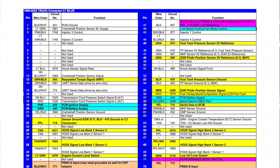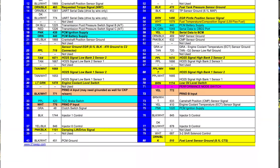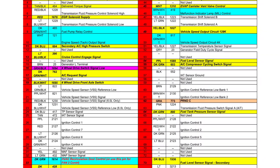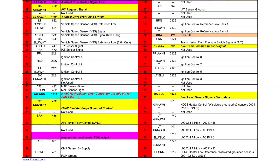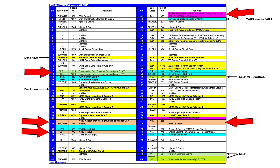The chart on lt1swap.com tells you how to do wiring if you're running the engine as a standalone system, but I'm keeping things like AC and cruise control. Some wires marked yellow I'm actually keeping and highlighted green on my chart. I also want to control a 4L80E transmission, so I'm keeping pins 17, 18, 32, 34, 41 — which is gray on mine — and pins 72 and 79 on the blue connector. I'm also keeping the orange and black wire on pin 80 to try to connect my fuel level gauge on the old instrument cluster.